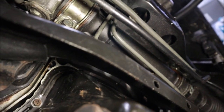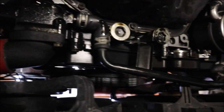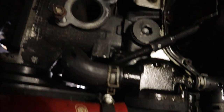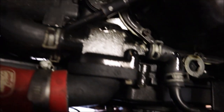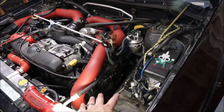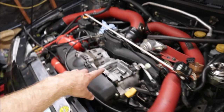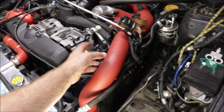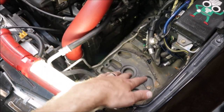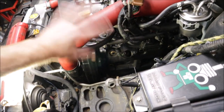It's really hard to see back there by the flywheel. I really don't think it's causing all of this. So what we're going to do is change the valve cover gaskets and clean all this up, see where it's coming from. To get access to the driver side there are a lot of plugs — the main harnesses here I unplugged and tied out of the way. I undid the alternator harness, AC compressor clip, pulled everything out of the way, removed the battery. Then you can get to the filler neck tube, which I already removed.